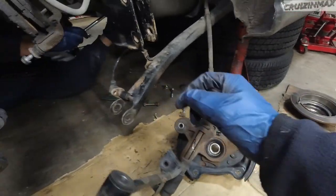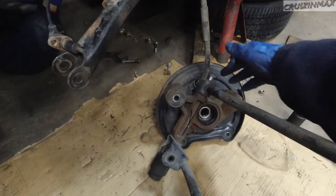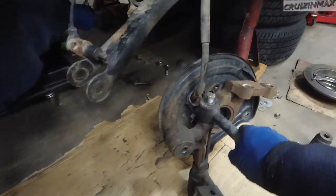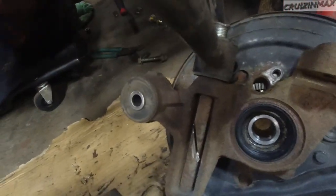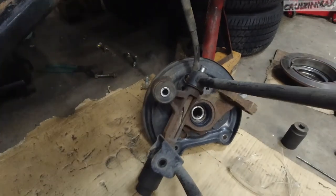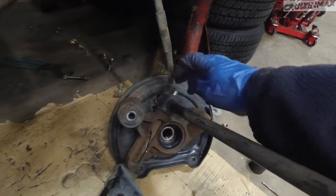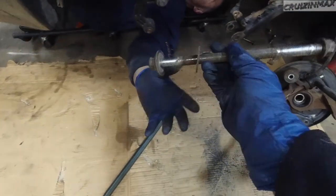It's just hanging on the parking brake line so we decided not to take that apart. We tried knocking and got nowhere, so we put it in more or less this position and started cutting. I ran out of room and was ever so slightly cutting into the knuckle. The plan is to break this apart — this piece comes out one way, and the other part, since it's spinning, should come out once the bolt is free. Then put it in the press and press it out.